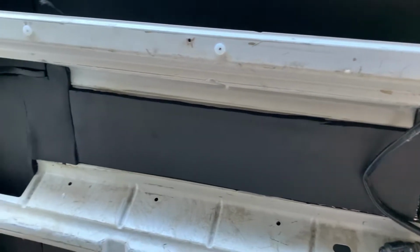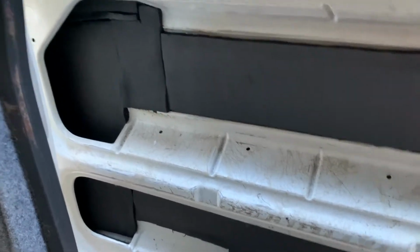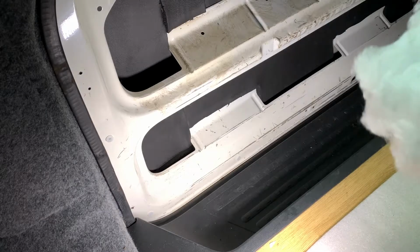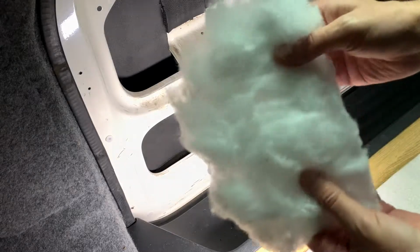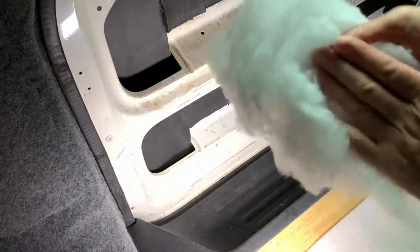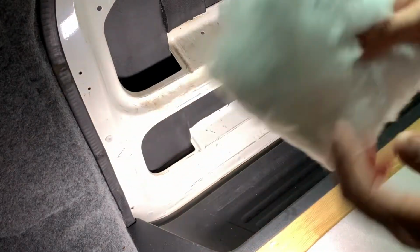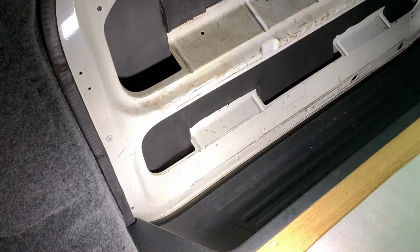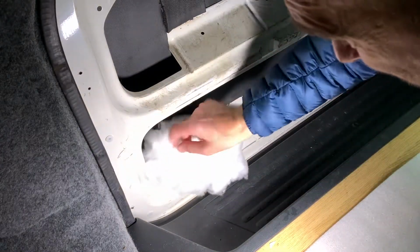I'm going to be putting recycled bottle insulation in there as well. This is just another added layer. I don't know if you've ever worked with the fiberglass loft insulation before, but it is a nightmare, really itchy to touch. But this stuff is just amazing. There's no reaction to it at all, no itching. It's just really good. So I've just torn off a small, narrower piece, and I'm basically just going to ease it in to here as best I can